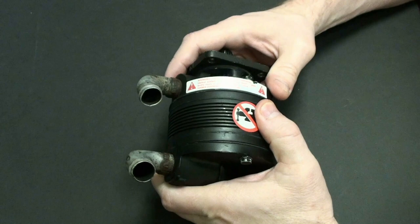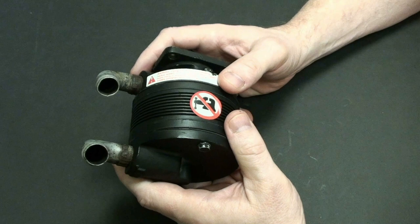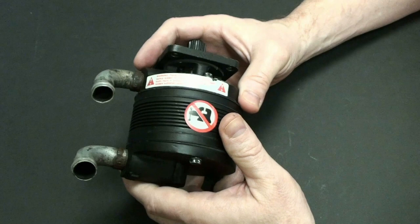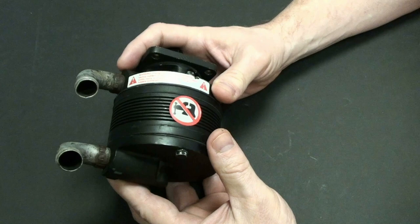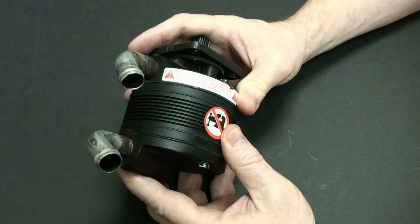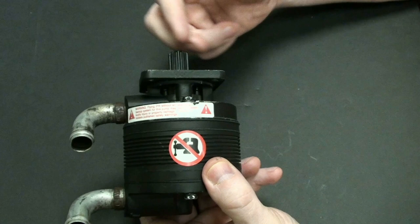Okay, so first off, we're going to start by looking at some general things. Two hoses. One's an innie, one's an outie, so that's very important. One creates suction, and the other creates a positive pressure or blow, which can be used for things like pressurizing the aircraft cabin or blowing up pneumatic boots on a de-ice system for some light twins that I've flown. If I knew that the vacuum pump failed, I would lose pressurization inside the airplane, or I would lose my de-ice system. So this is a very, very important system here and can be more than just a vacuum pump.